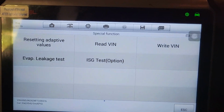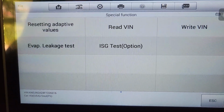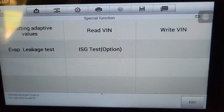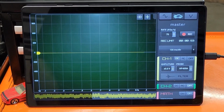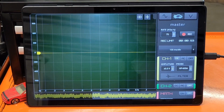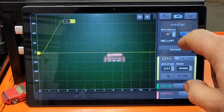We're going to just go at it with the scope. We're going to use the HScope 512, and we're going to just do a relative compression test, see if it shows us a dead one. I mean, I've heard some misses make some pretty weird sounds, but all right, I got it. The tripod aimed at A7, and I'm just gonna crank the key with my foot off the throttle, and then I'm gonna push down on the throttle, see if we see a difference anywhere in there, just for curiosity.